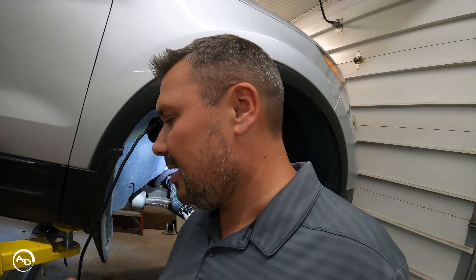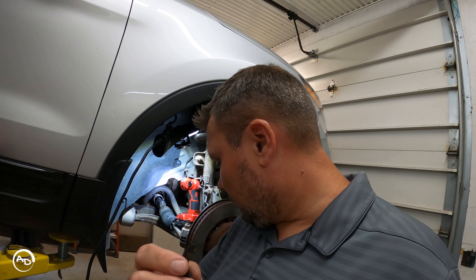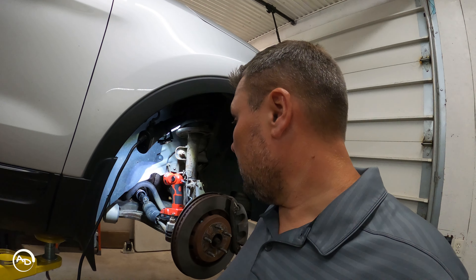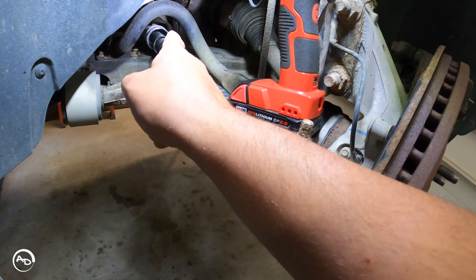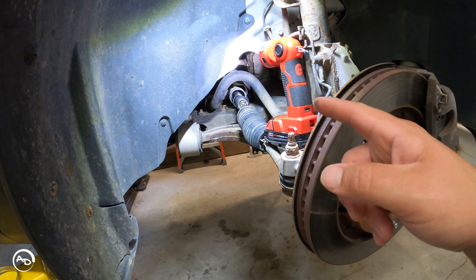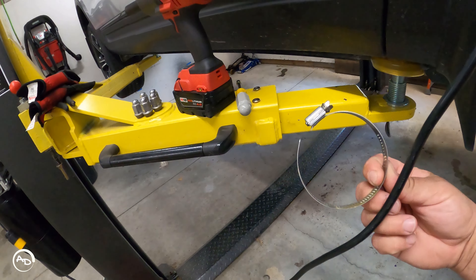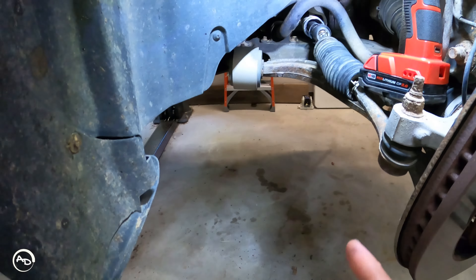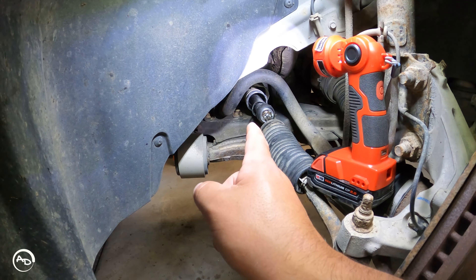I've got a hose clamp to put on in place of the original. It's not just the ring either — there's also this thing that fell to pieces all over the floor when I took the boot off, which is also a common thing. The boot is held on by a pressure clamp on one side, but up at the rack end it's a one-time-use crimp. Easy to take off with a couple taps with a hammer and a screwdriver. After I get that ring off I need to put the boot back on, and I've got a hose clamp that'll work — I can get the nut driver in there just far enough.